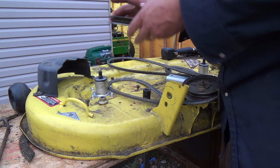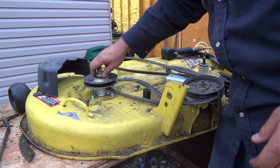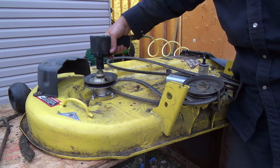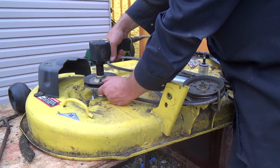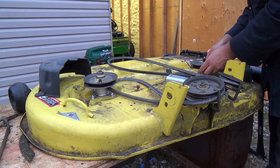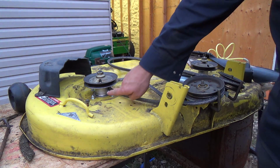All right, then we've got our pulleys. Hopefully they're still all right. I guess they'll jam in again. There's a bit of wear in them. But if you hit something, that's definitely going to be problems for your pulleys too. If you hit too many things, if you haven't wrecked your deck already, you'll end up stripping those things out, I think. Should be good. And our other one's over here. Oh, and they put the greasers on the top of these ones here. See, where the other ones were jammed under the side.